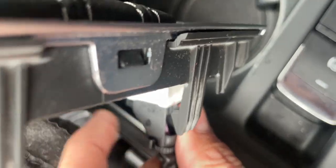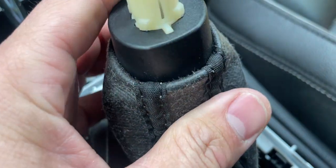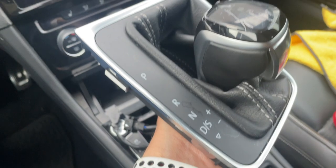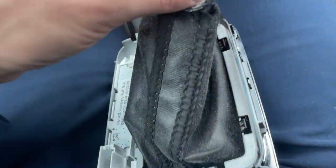This little wire right here, you're gonna go ahead and unclip that. Next you want to move this black collar up over this white piece — you're gonna push this down and kind of use a flat head to pry this up. Then just push your new knob through here.